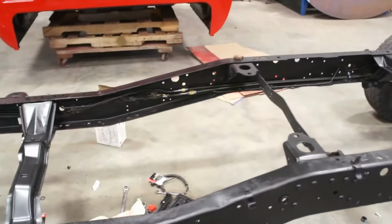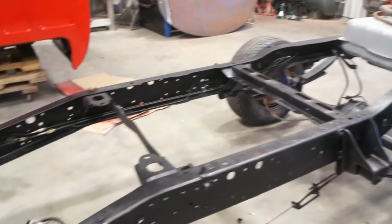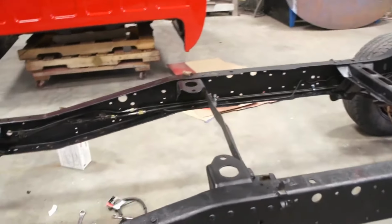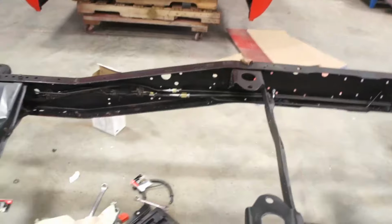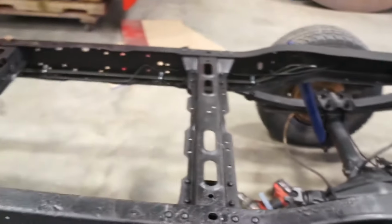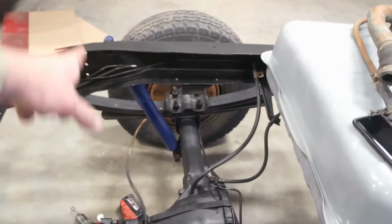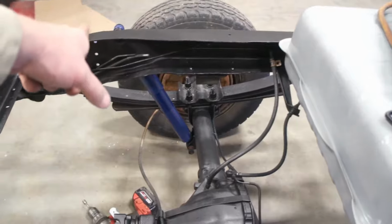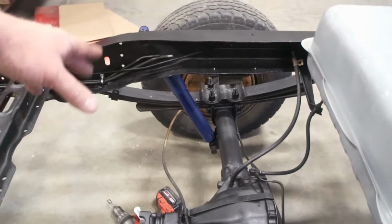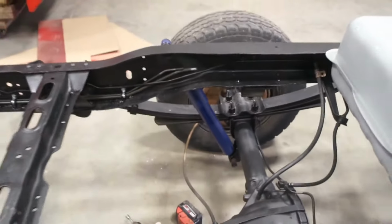Okay, so I have the hard portions of the new fuel line going in there, all done. Hard as in steel lines, not rubber. Got our nice connections, got three of these rubber line clamps in there. Everything's nice and solid. I wouldn't mind a fourth, but at the very end, right in line with the shock, I don't want to do that. It's pretty well secure, so I'm not too worried about it.